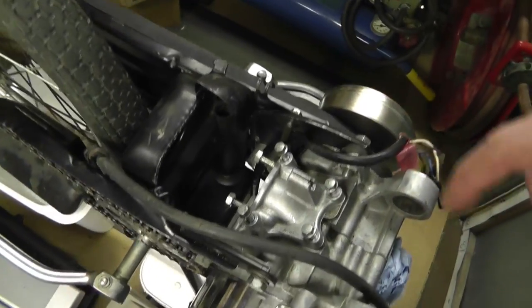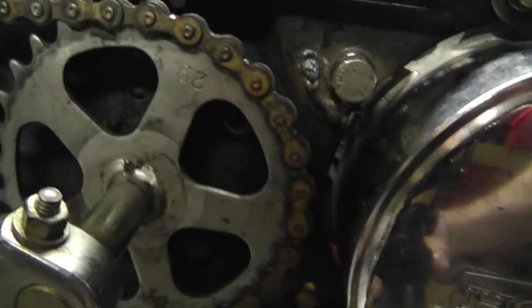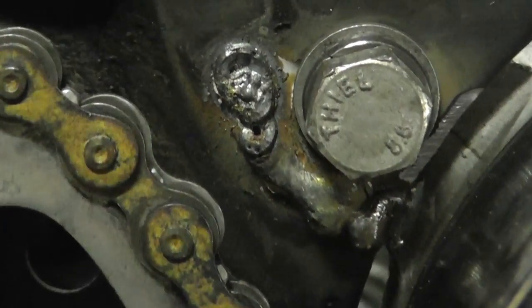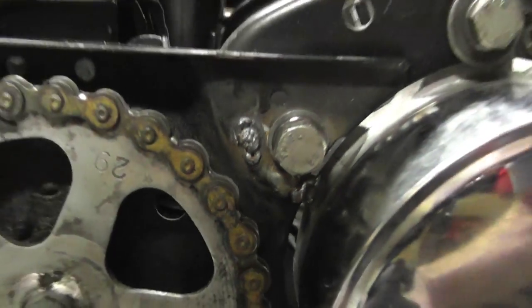I did have a cracked frame. I have a welder — you guys know the one I used for all my crazy experiments — and I put it back together. I re-upgraded the diodes in it because it blew all the diodes apart, and then I figured out I had it half-wave bridge rectified instead of full-wave bridge rectified. That was the entire problem. I fixed it, but I didn't have any welding gas.